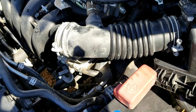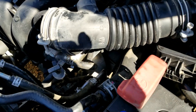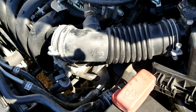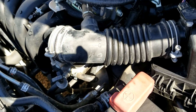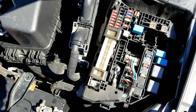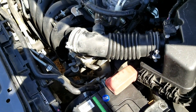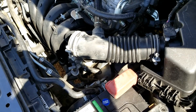That's basically the way it works — you spray starter fluid into the air intake, ideally straight into the throttle body, and see if the engine starts. It won't run long, only one to three seconds at most, but if it starts at all and wasn't starting before, you know it's a fuel-related issue, most likely the fuel pump. Be sure to check your fuses and relays. If you have an inline fuel filter, it's a good idea to swap it out since those can get clogged. If you have any questions, ask below, and if this video helps you, please click like and subscribe.